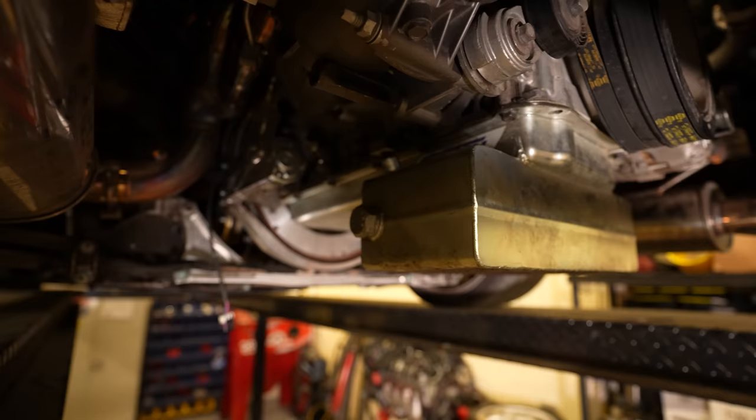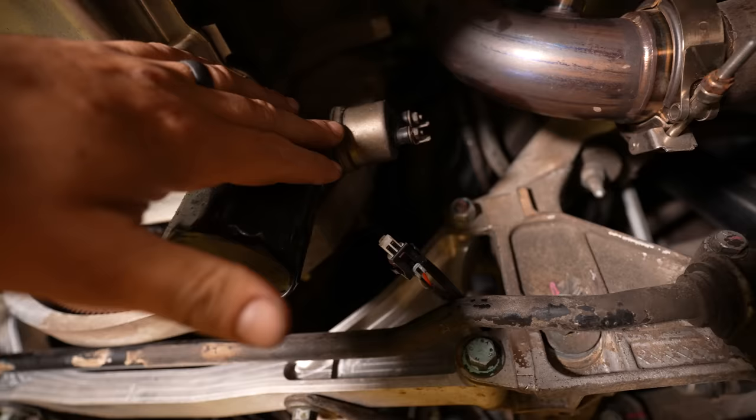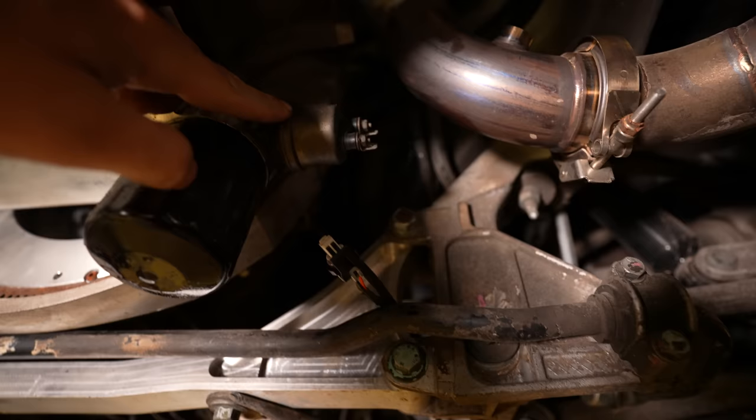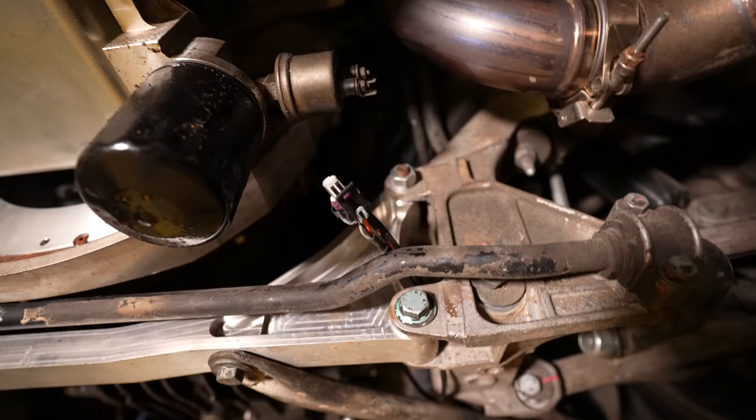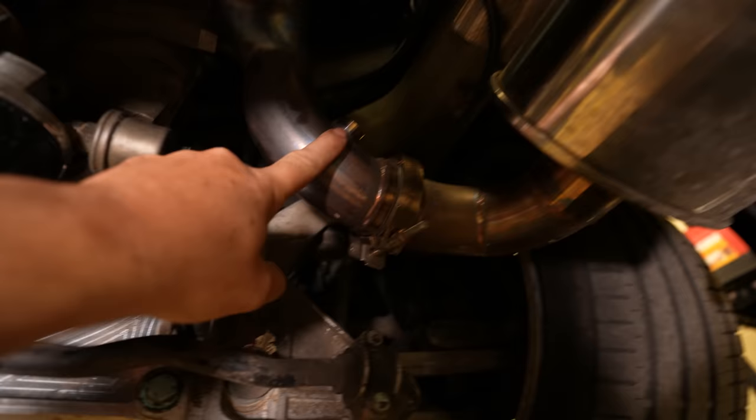The coolest part - well, what's super convenient - is you can take this oil pan off in three minutes. So when it comes time to do oil drain lines for the turbos, that won't be a big deal, unlike a lot of front-engine cars. Here's the trans adapter, flywheel, and they charged extra for the dirt on the transmission. Crank sensor is in place - I'm going to need to get an extension harness for the cam sensor since it's in the front. And here's the Porsche oil pressure sending unit - it's kind of big and doofy. I'll probably move this up on top. I don't want to have 700 things teed off here, but we need oil supply for the turbos. There's an oil pressure sensor plug - obviously can't plug that in until I put the sensor in place.